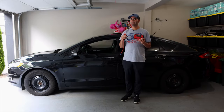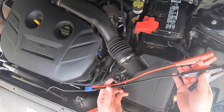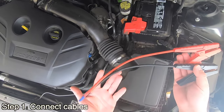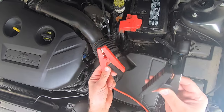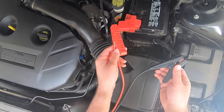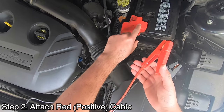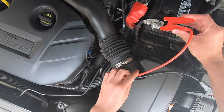I will link the one that I'm using today in the description box below. So let's go ahead and jumpstart my car. We've got the cables that are included, and you do want to attach these first before attaching them to your battery pack. Red is positive and black is negative, so you want to make sure you connect those properly. We're going to connect positive first — this is my positive terminal — so let's go ahead and attach this right onto there.